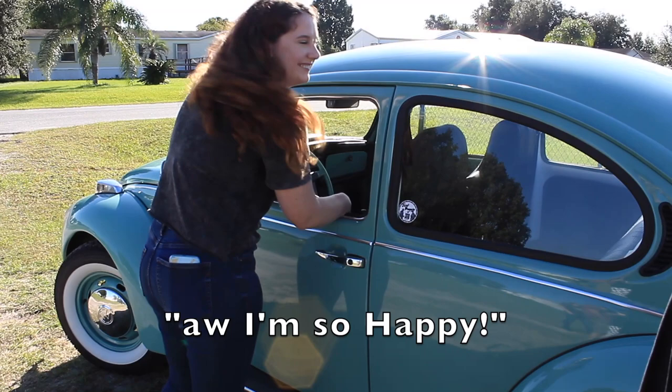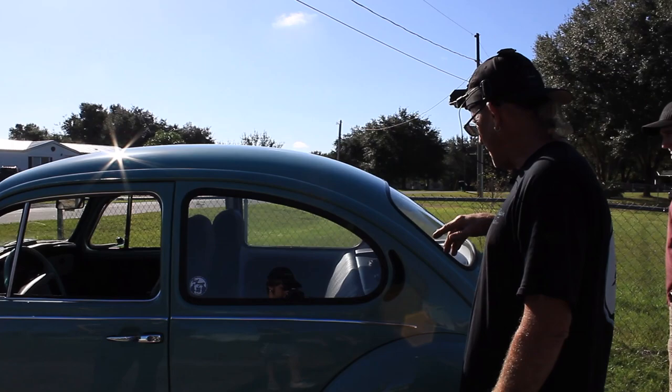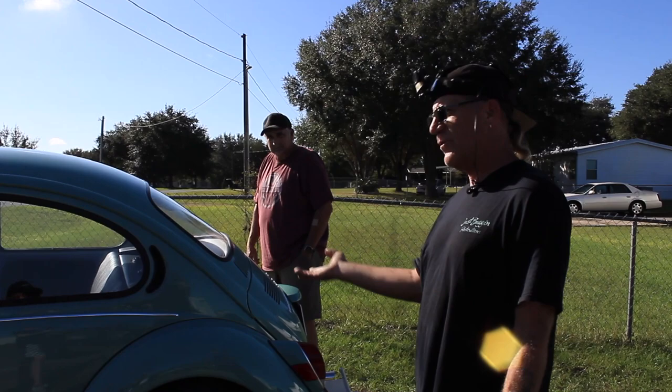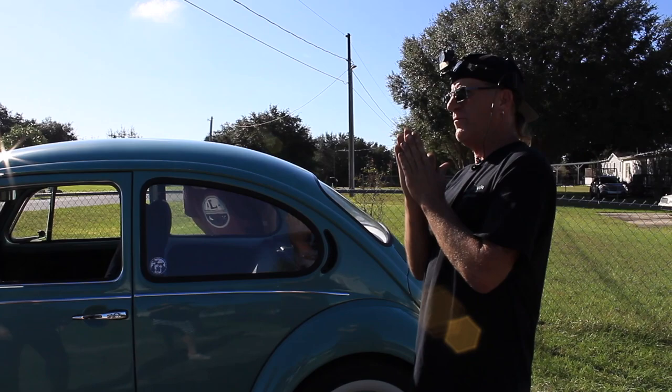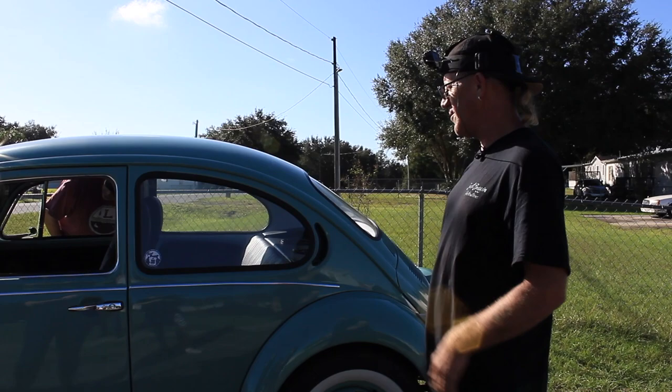I did see a couple of times, I don't know why, but I noticed when I went under that the LED lights, it was like magical. Maybe it was the prior owner, his father passed away before they could restore it. But I come out and the neon lights are on, and I go on my phone and turn it off. So I looked at the plug where it comes up on the side and the female end faces up. Maybe a little moisture got into the plug and crossed the connection to make it turn on. So I sealed that up yesterday thinking that might be a way.